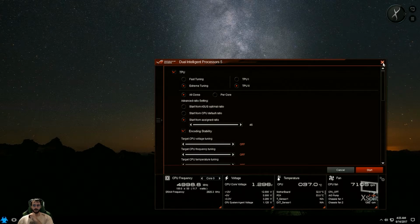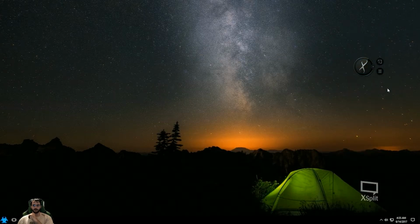Anyways, that's just a little overview of different ways you can overclock. I know I was kind of all over the place, but I wanted to be pretty thorough. I hope this video helps you get more comfortable with all the settings. They're basically all the same thing, just in a different format. When you go in the BIOS, it seems more scary because you don't want to mess anything up. But you really shouldn't have to worry because you could always just reset the BIOS back to a default setting. And you saw even earlier when I did the 17% overclock and I had to power down and restart, it caught that, adjusted itself and booted back up just fine. So it's really hard to mess up pretty bad nowadays.